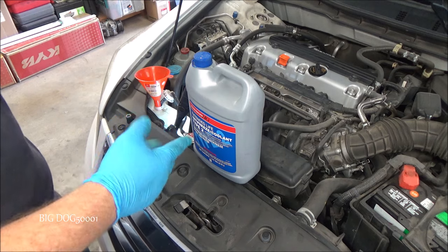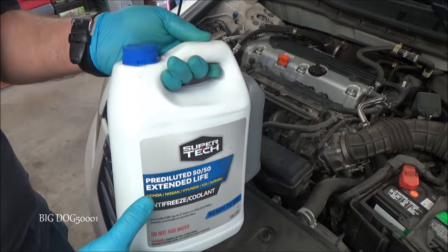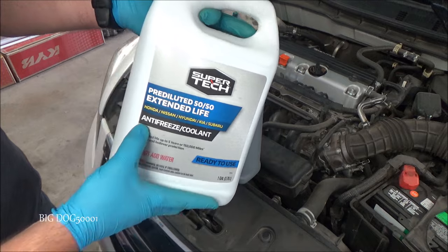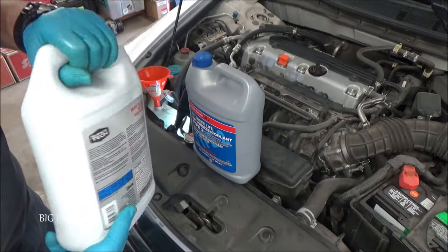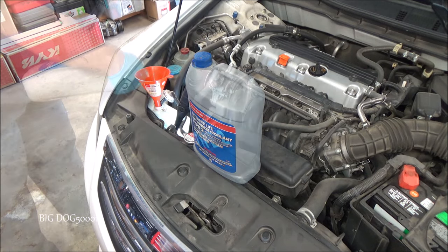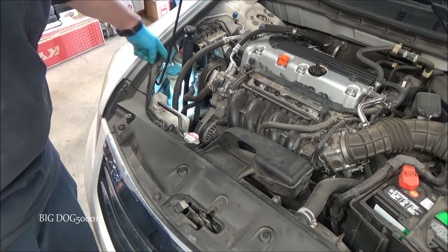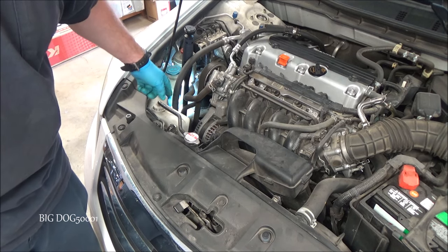For Honda coolant, I still like to use genuine Honda coolant, but I'm not opposed to using stuff specifically made for Hondas. As long as it's blue — I don't like to put red stuff in there. I've seen products that say they're okay for Honda but are red. As long as it's blue, says it's made for Honda, and is silicate and borate free, I'm totally fine with it. Don't forget to check your wiper fluid too — just remember, wiper fluid is blue and so is Honda coolant, so don't get them mixed up.